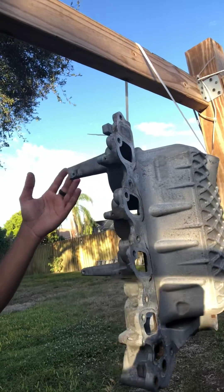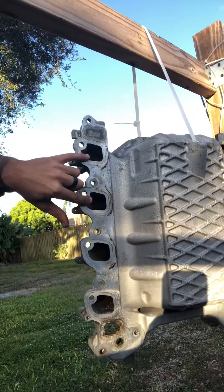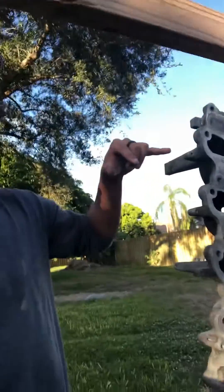The reason I'm going to do that is because I heard these cylinders right here — cylinders seven and eight — they get pretty hot. With this mod it should help the cooling. Also when I get a dyno, I'm going to ask my tuner to run a little bit richer on these just to keep the temps down, because I heard a lot of people mess up those two cylinders mainly on a factory setup with more heat and more boost. So that's going to be the next upgrade to this intake.